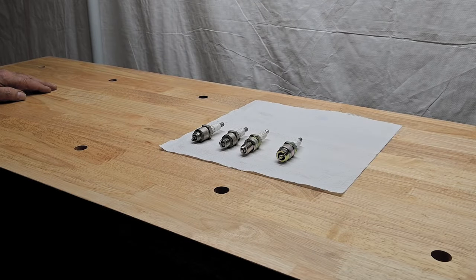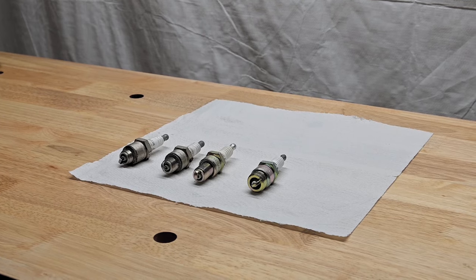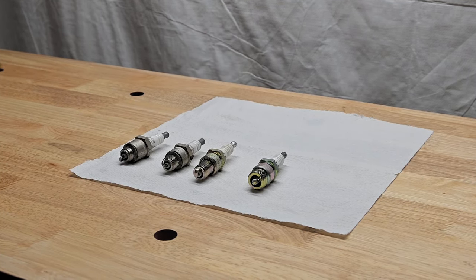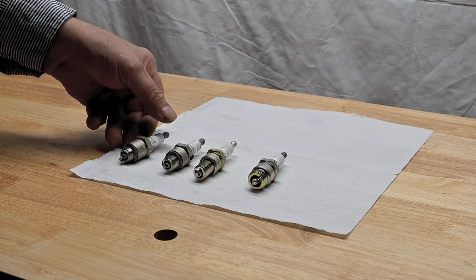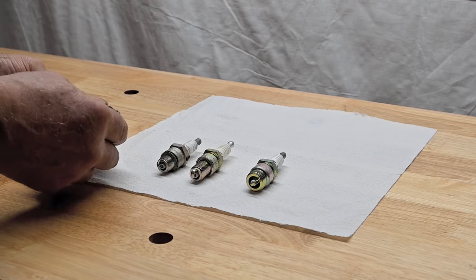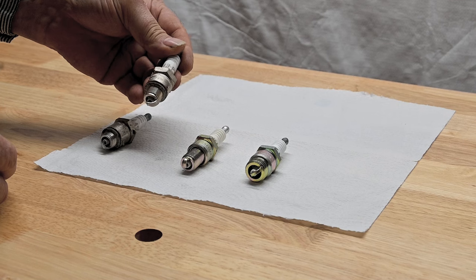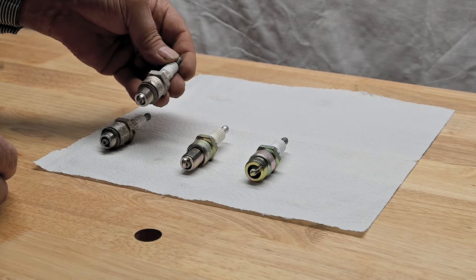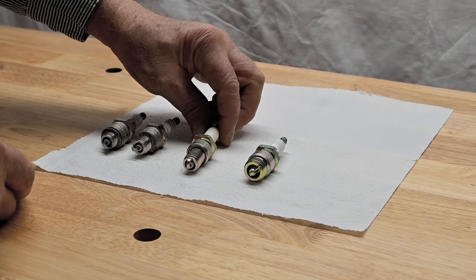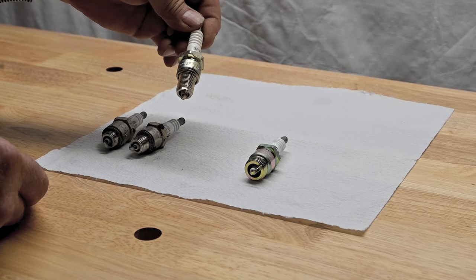We're going to talk about the spark plugs that we all take for granted today. New spark plugs aren't interesting hardly at all. But they helped make the country grow really quickly with innovation in so many fields. These are the common sizes used today. The thread size here is 14 millimeter. The distance from here to here is a half inch, and these are used on mostly old small engines, lawnmowers, power equipment, and some vintage two-stroke motorcycles. This longer one is five-eighths, same basic thing just a longer thread base. And this is a three-quarter inch — there again, 14 millimeter thread size, used in almost everything with gas engines today.